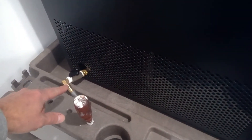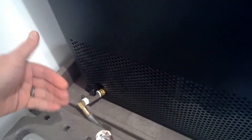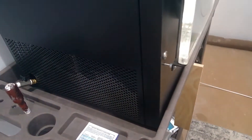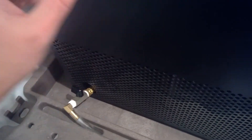You'll also see this valve right here — this comes out of the back of the unit. It's open right now because it's parallel with the line, but when you turn this sideways and it's perpendicular to the line it actually seals the air off from the unit. So when the pump is on, anytime you're running this machine you want to make sure that is closed — perpendicular. The only exception is I think it's specific to my pump, but it exhausts any kind of water at the end of a cycle and recommends you keep this open at that point. This valve being closed is so you can get a good suction inside when the pump is kicked on so you can get that sublimation process.